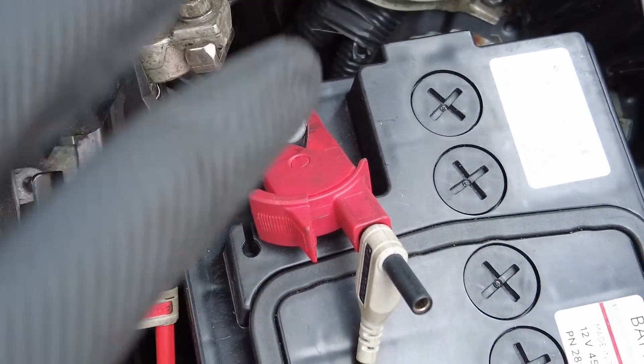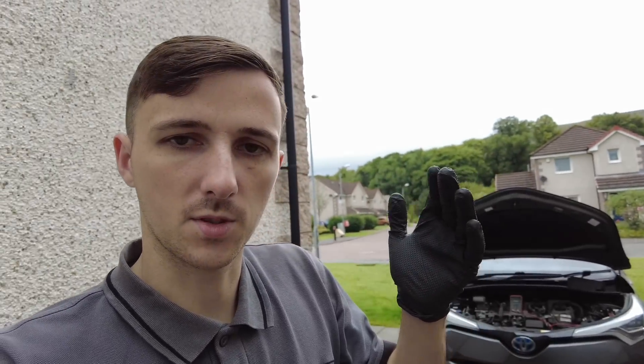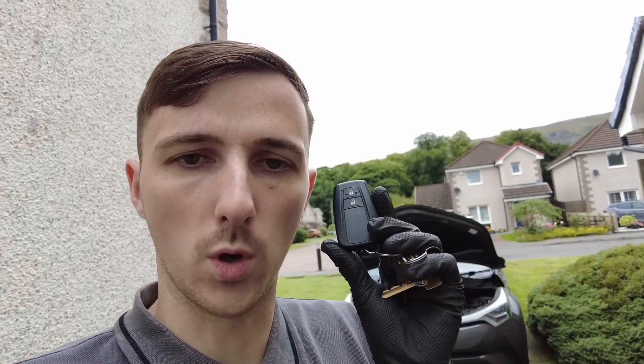That is our battery connected in series with the earth terminal. We know that 240 milliamps is far too high. So what we're going to do is a volt drop test across the engine bay fuses and also across the passenger compartment fuse box, just to see what's drawing this current. One thing you need to be aware of with this particular car: once you go close to the doors, the interior lights will automatically come on if you've got your key in your pocket — so the key needs to be far away from the vehicle to carry out this test accurately.